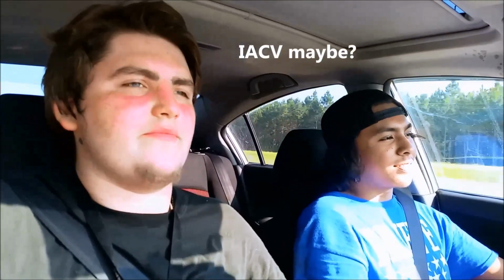Alright guys, so we're obviously in the same car, which means I'm not taking the 240 home yet. We're gonna leave it back at the shop, Grandpa's friend's house, and he's gonna work on it a little bit more. We made it run better, put a whole exhaust on it besides the headers. We were gonna do that, but we were like, screw that. So we left the stock headers on because they were fine. I just bought a whole new exhaust for no reason, kind of. I just wanted it. New battery, new fuel, put premium in it. Kind of sounds like it has a misfire. Definitely an intake or vacuum leak, because it doesn't want to idle, and you have to keep it idling. It's still really loud. It still sounded good. We drove it.